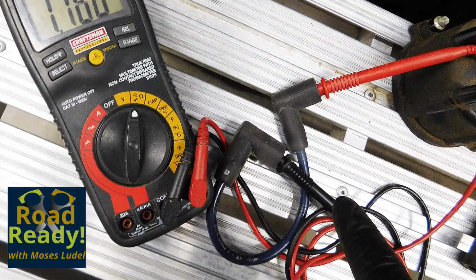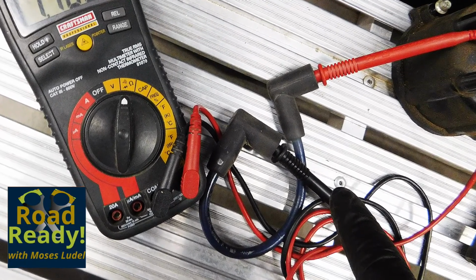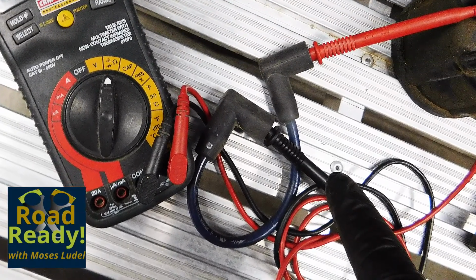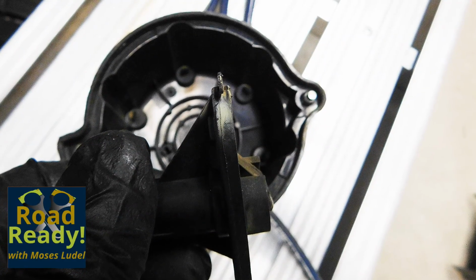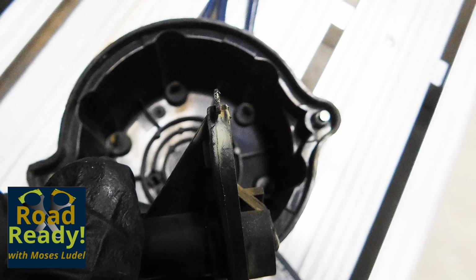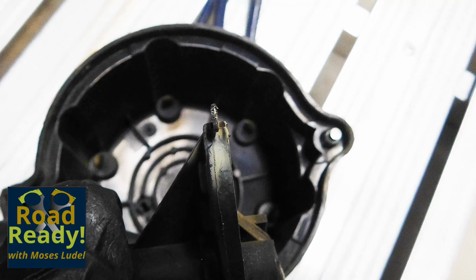This high-tension coil wire carries more load than any of the spark cables. In the case of the six-cylinder engine, this high-tension cable has carried six times the amount of spark voltage of any other wire. This cap, rotor, and spark plug cables, OEM quality, have been on the engine for 60,000 miles. I expect performance and fuel efficiency to improve somewhat.